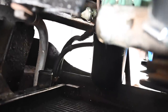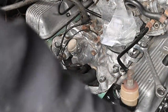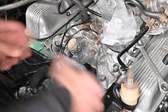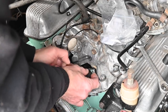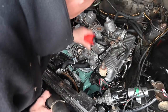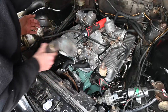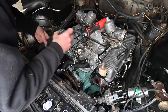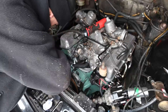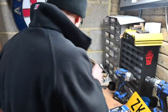That little water pipe access is infinitely easier if you take the distributor out because it really is impossible to get on otherwise. Let's not forget to put on a couple of hose clamps, otherwise that will be a rather damp situation in the engine bay before too long. Done. Access has been my constant issue — as well as taking the distributor off I also had to take out the radiator coolant hose while trying to do the transmission lines, so those go back on again.